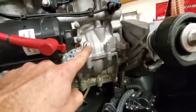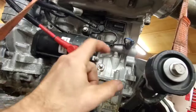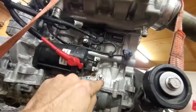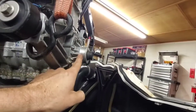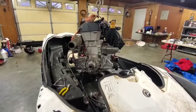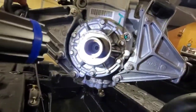What I saw online, they were talking about taking this bolt out over here — either a bolt right here, which is kind of weird how that's already taken out. See, that's got a mud dauber nest in it. So it's either this one or this one, and they say you take it out and put a longer bolt in it, and make sure the number two cylinder's on top dead center. This locks your crankshaft — it's a locking pin. Then you take this snout off on the end, put a giant pipe wrench on it, and they say it's tightened at like 200 foot pounds of torque. So a five-foot cheater bar and a pipe wrench, and you just loosen it. She's a little chewed up in there. Yeah, it was drilled out. That is absolutely ruined.